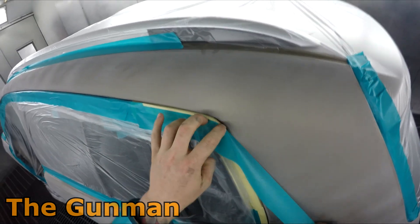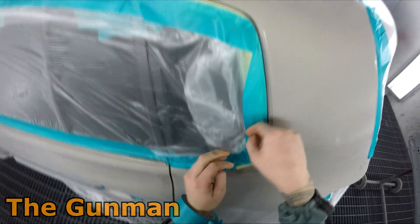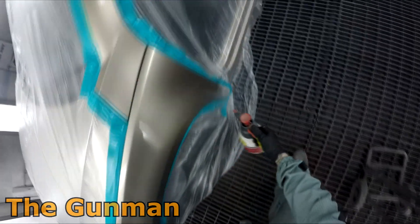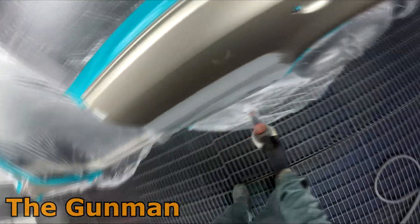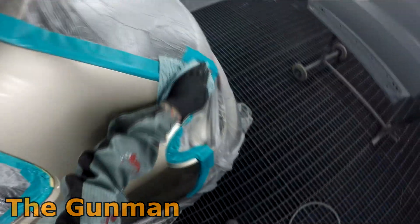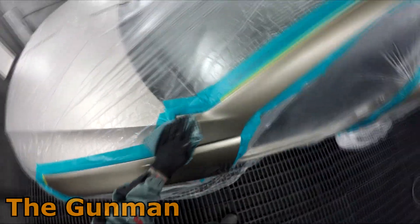Obviously choose your battles - if you're doing a black or a solid color, it's going to be a little bit more forgiving and you might be able to use the 800 grit. I've found that the 800 grit sanding sponges we are using now are a little bit coarser - I'm using the 3M ones. I've still been using the 800 grit on the orbital to sand those blends down, so that's still fine. I'll probably make a specific video on my prep methods for the water base.